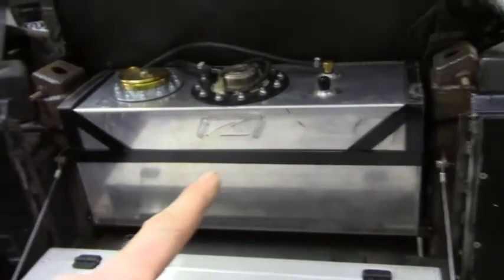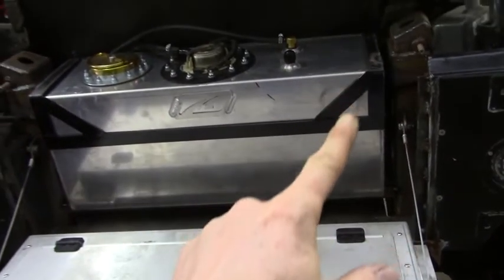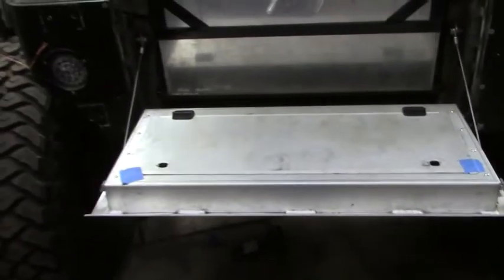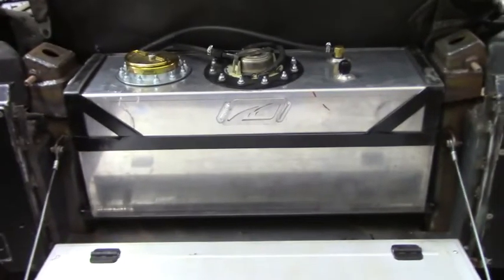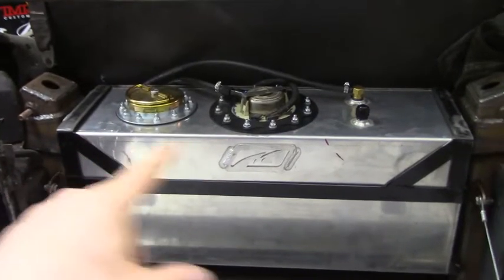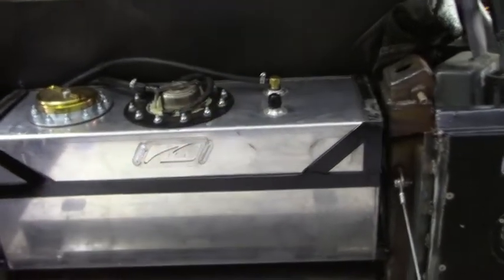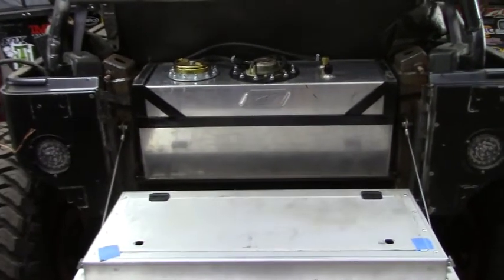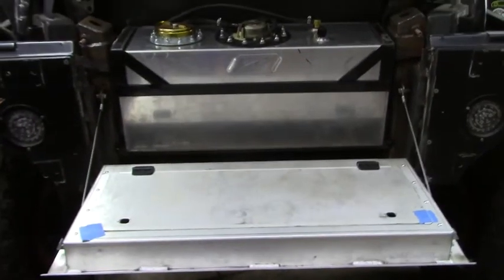We're all done. One thing you'll notice is the custom setup I made to hold down the fuel cell — the hinges on the Rockman storage tailgate were hitting the MotoBuilt cell, so there just wasn't enough room, which is why I added those straps. Looks pretty good and will hold it down well. On the return line where it goes down the Jeep, there's no fitting down there — you just put the line over the fixed line and hose clamp it. Other than that, we've got to fill up the fuel and you might have to prime it a little to get fuel up through the hose. Hope you guys enjoyed this video — if you have any questions or comments, let us know, and don't forget to subscribe. Thank you for watching.